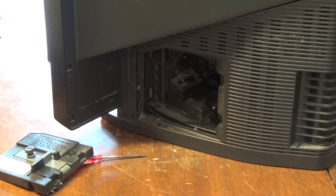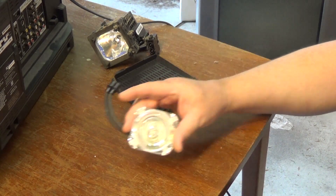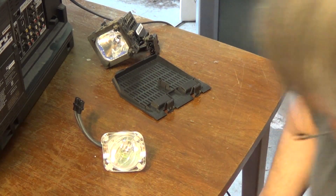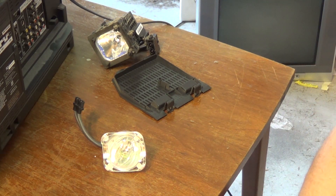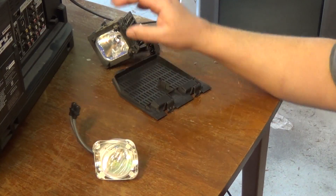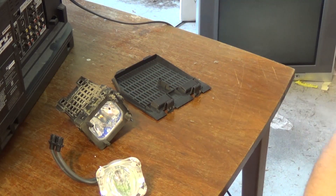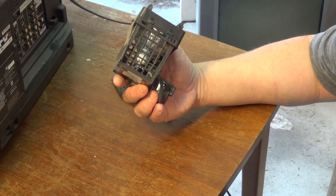I'm going to look through my pile of old lamps and see if I've got one that can fit into that housing. It just so happens I do have another lamp which might fit — this one came out of a Samsung DLP. It was actually a generic lamp that a friend's son put in, but it was the wrong housing and he forced it rather than swap the bulb, so this lamp has essentially zero hours on it. It looks like it might be the same physical size, so if I can make it fit I may be able to get this TV working.